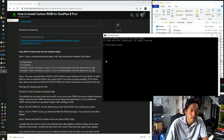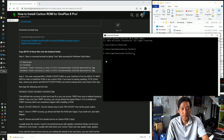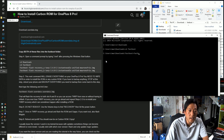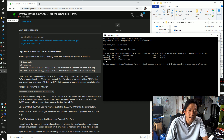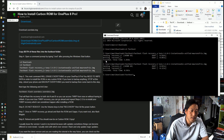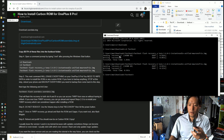Open a command prompt by typing CMD after hitting Start. Type: cd downloads, hit Enter, then cd fastboot. Now type: fastboot flash recovery a [twerp filename].img — this will flash TWRP to slot A. Then hit the up arrow and change 'a' to 'b' to flash slot B as well. This installs TWRP on both slots.